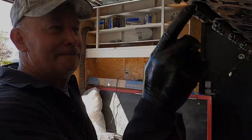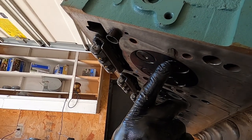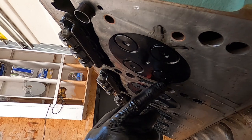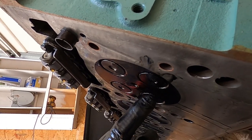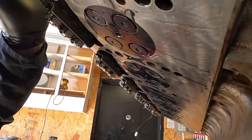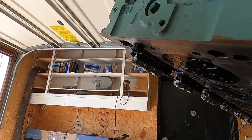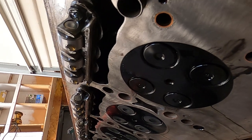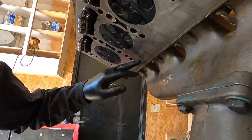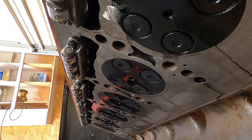This one's definitely a project. With this head — if you'd have put N-series pistons in it like before, you're only allowed six thousandths protrusion on the valves before they hit the pistons. That looks like it's in there crooked — these stick out of the head and would have been close to hitting the pistons. This side is in further than that side. See that? That's all rust and they just sanded it off and put it all together. We should have that machined.